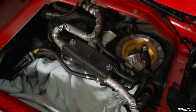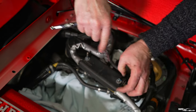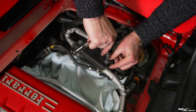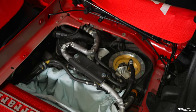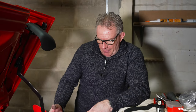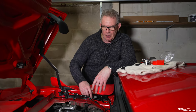Reversal of the removal procedure — just nip the bolts up again, being careful not to drop any tools into the engine compartment. I've realigned them with the blue marks so I know those were the correct torque positions. So that's the purge valves done. It's taken me twice as long because of narrating, but as you can see it's quite a simple job. Save yourself the hassle and cost — replace them yourself. They're only about £80 for the two new purge valves and the new ear bracket clamps, and not too difficult to do.